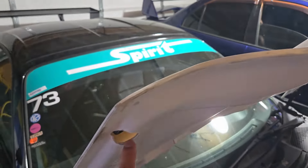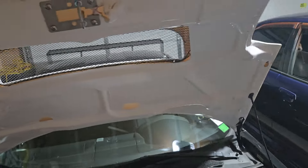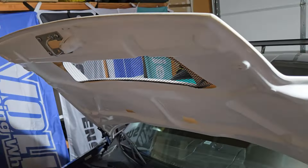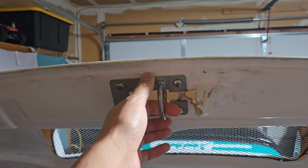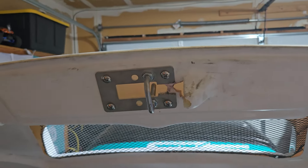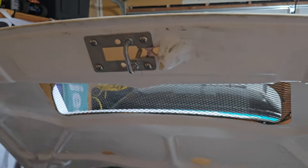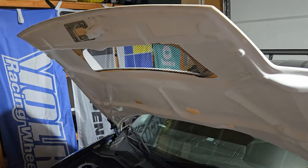Of course, I added these little hood pins on the side just as an extra. If you're running an aftermarket hood, you want to do that with any aftermarket hood - like carbon or fiberglass, whatever. This is actually very sturdy, but this could possibly rip the fiberglass or carbon or whatever material it is. I've seen it with a carbon hood and fiberglass hood, so just be aware of that.